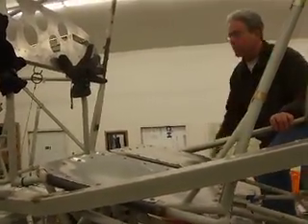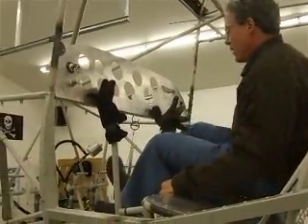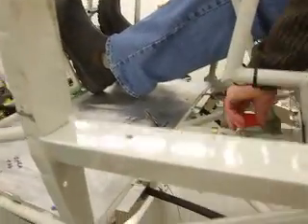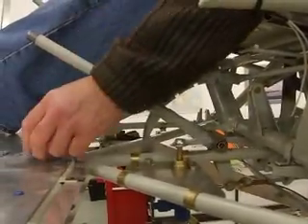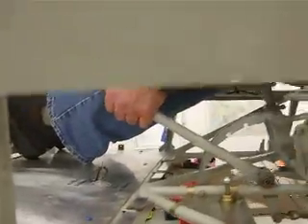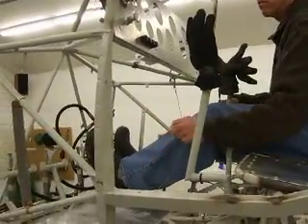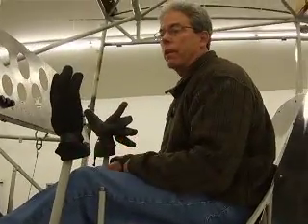Rob demonstrates the water rudder control inside the cockpit. You have rudder controls, elevators, and flaps. The water rudder control is spring-loaded and drops down when the floats are hooked up. You can easily operate your fuel selector valve, rudder, and flaps. Importantly, the strut is welded so the water rudder control cannot foul the flaps. To operate: hook it up, lift against the spring this last inch and it drops down — up to release, then down. The water rudder itself is dropped by springs in the back. Simple and reliable.